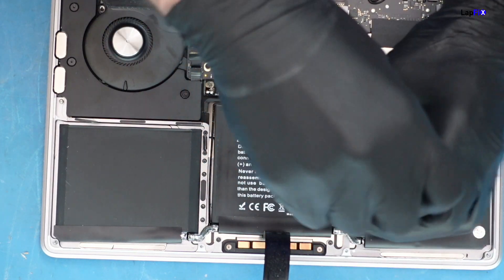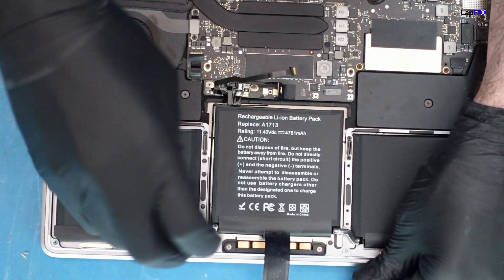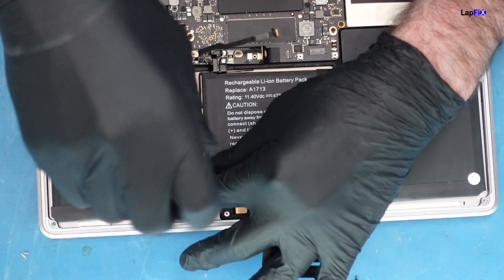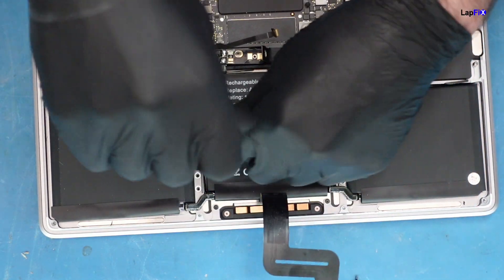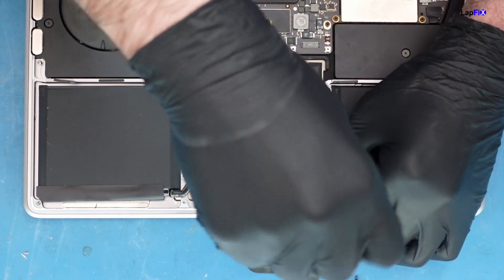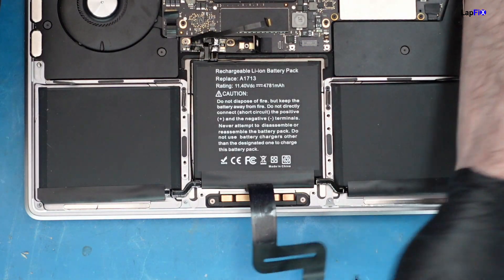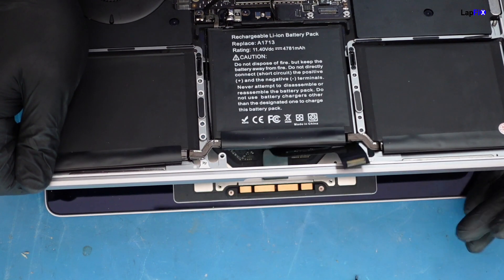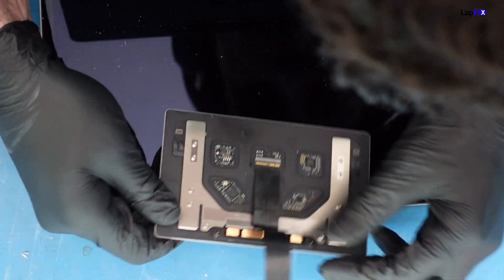We're looking for either damage, missing components, or the easiest scenario — a connection that's just a little bit loose. A disconnected connection will make the fan go nuts. This happens in a lot of other models too: if you don't have IO board connections, audio connections, or certain critical connections, the fan will get really really loud. It can also go really slow and it will still boot but won't be in a usable state. That's obviously why they're here — the customer is worried there might be a sensor issue, but I don't believe that's the case.